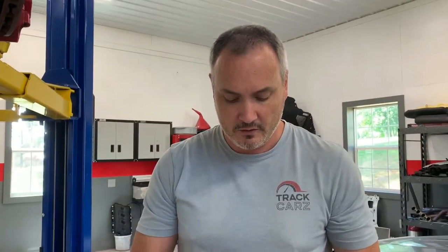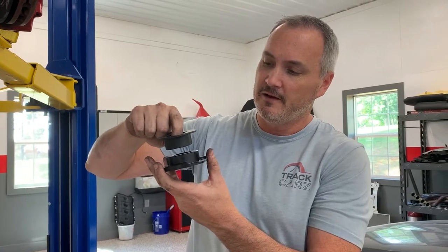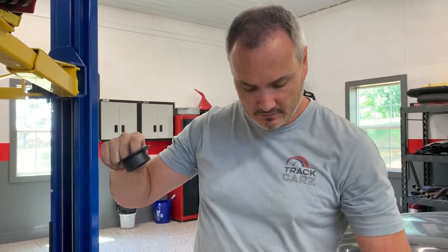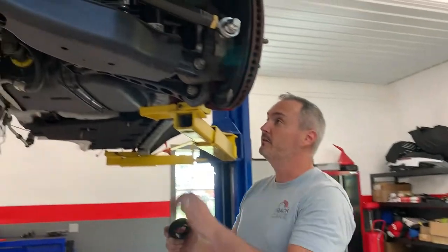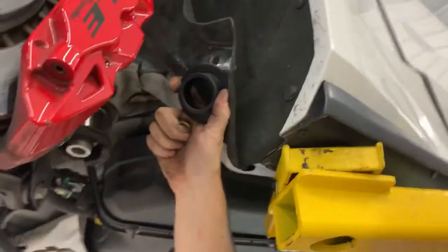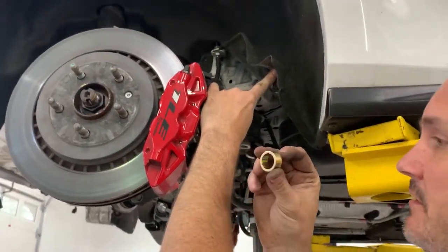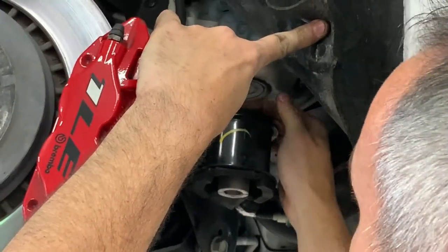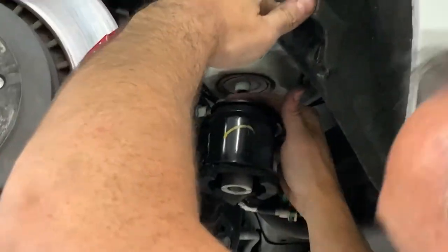All right, what we're going to do now is go ahead and install the first set of bushings on the front of the cradle. These will, like I talked about earlier, take up all the slop in the rubber bushing there. So in order to do that, we had to remove this brace. And now we're going to start installing the pieces to make up the new joint. I know it's a little hard to see, but you'll have to come to the outside over here, Travis. So the first step, following along in the BMR instructions, is install this little hardened spacer that just drops right in the top. And then you drop this little top hat piece right down in there. You do that on both sides.